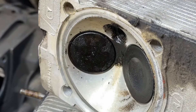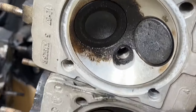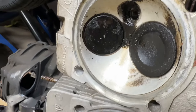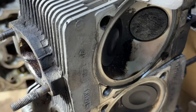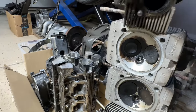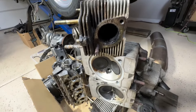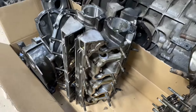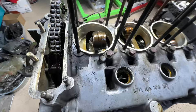Here's the heads. You can see that the actual dome in there is pretty clean on most of them. All the sealing surfaces, as you can see, were actually really nice — there was no leaking at the top of a cylinder. Number two was probably the worst one that was really smoking, and it had a lot of buildup on the exhaust port. You can see they were pretty dirty. The cam towers look really, really good.